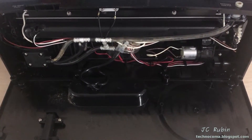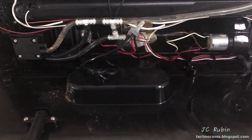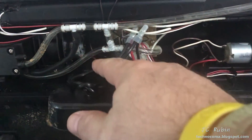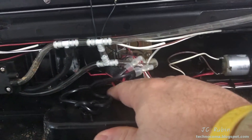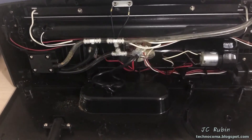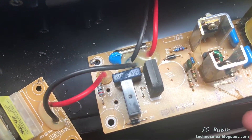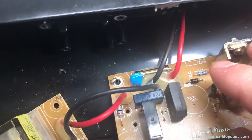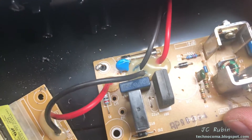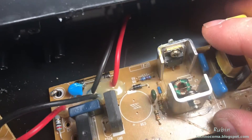Having returned home, I was hoping I could simply open the bottom of my machine — the automatic, industrial model — and look for the power supply down there, but only the controller board is in the bottom. The power supply and all electrical components are up top. It's not as easily accessible as on the smaller machine. Looking at this circuit board, I see a similar circuit, also internally fused — but with a much larger fuse on this automatic unit. I also see heatsinks here for two components, Q1 and Q2.